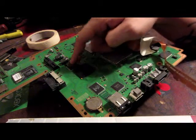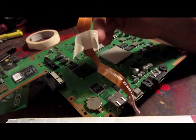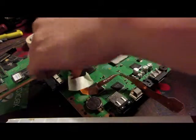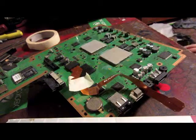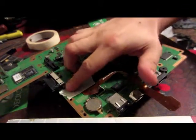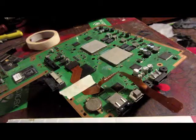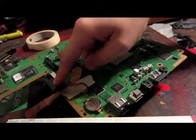The little circle in the corner — like I said, here's the top of the NOR clip, and where the ribbon cable comes out is the bottom. Also put a piece of masking tape on it so we can hold it down, and that way we can reroute the ribbon cable to where we want it to go. So first things first — the clip is now snapped on there. We can go ahead and lay down our tape. You want to make sure you lay it right here in the little bridge area, right in the middle, because then we're going to take this flap and fold it over so it's hanging out right next to where the hard drive goes with the SATA and power connector.